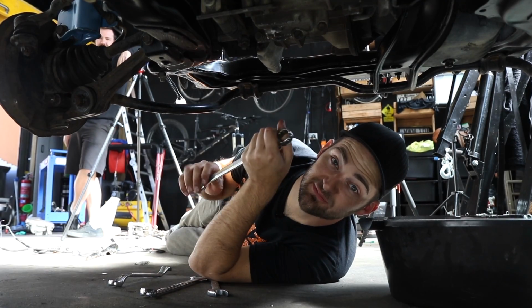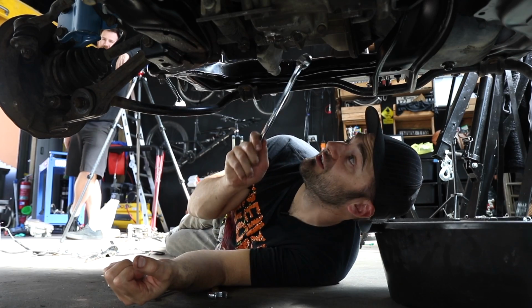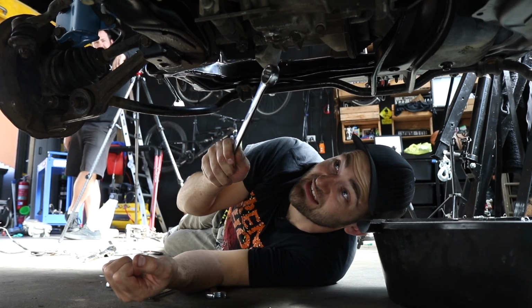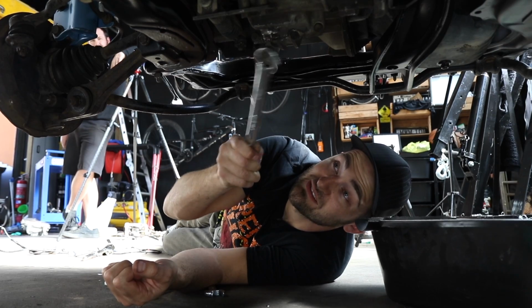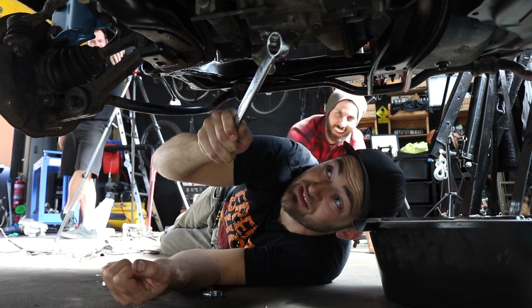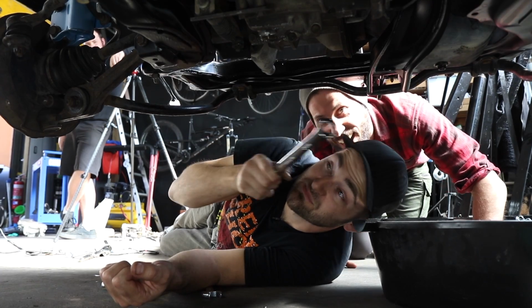It's time to start putting fluids into this mad car. This is where things start to get a little bit different. On this transmission, which is totally different from the Aussie one, you'd normally expect to see the drain just at the bottom of the gearbox. Instead, it's up the back, connected to this transfer case, and there's some printing on the box that says TM oil drain, which is a transmission oil drain. Then it says TF oil for transfer, and it has a little arrow saying that they're separate, so you don't get them confused and put the wrong kind of oil in.